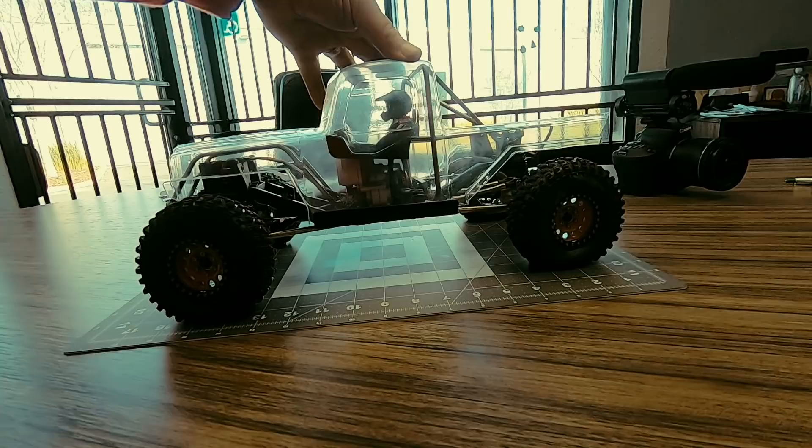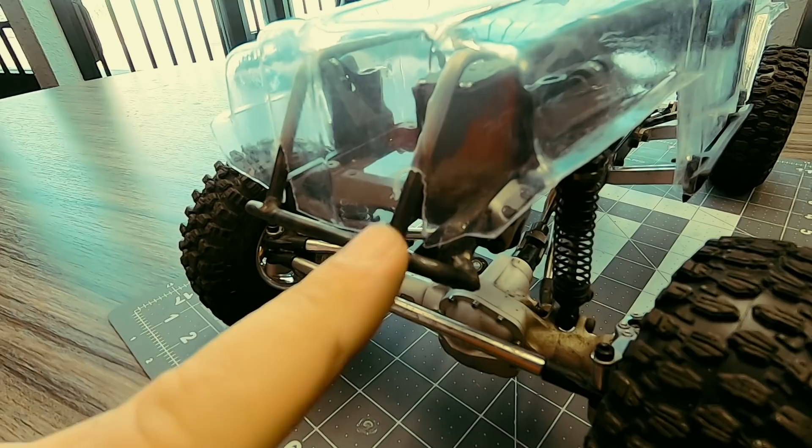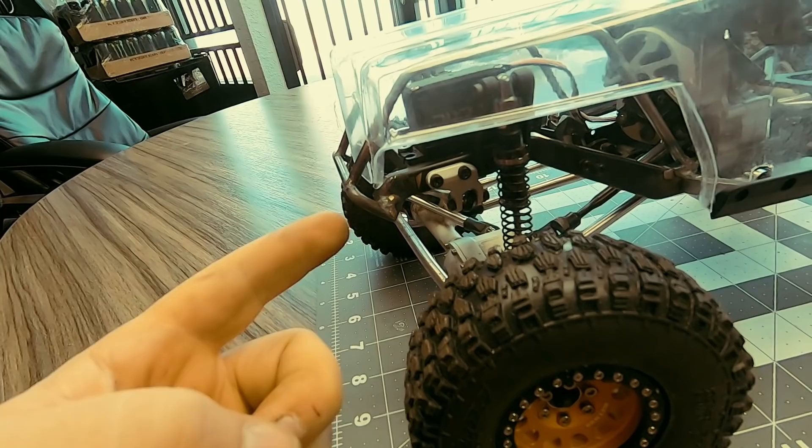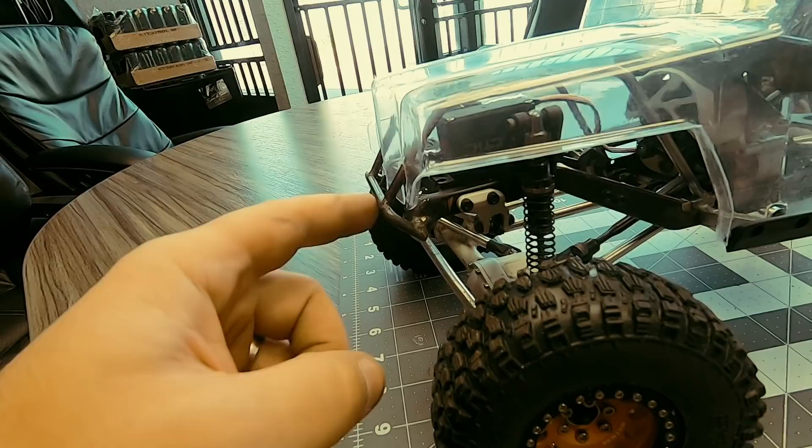The front bumper, you can see it kind of keys down in. Bars come through and tie to a very simple bar. I cut about three-quarters of an inch off the front of the chassis — it used to drop down and forward where the bumper mounted. Now it ends where the front of the chassis would have ended, but much, much higher. In the back I chopped a lot of it off, trying to keep that thing pretty short.